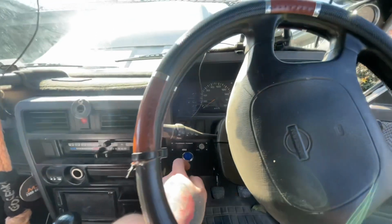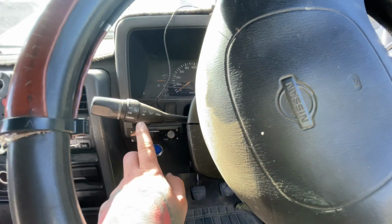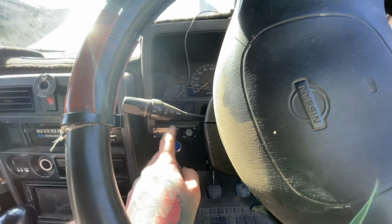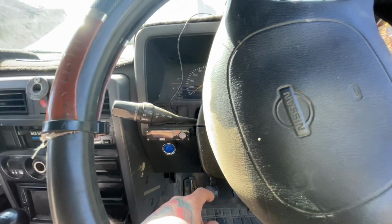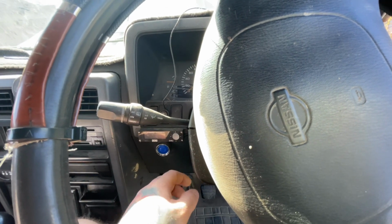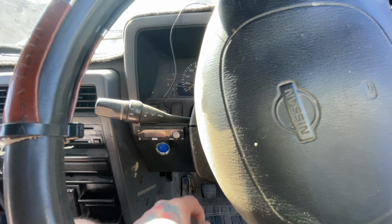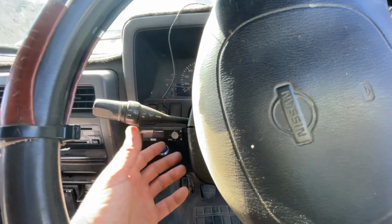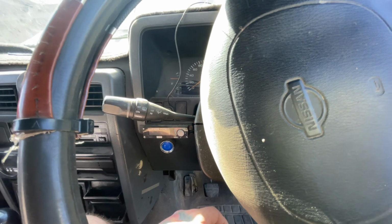I've got an HKS turbo timer, again, I got off eBay, I believe it was. You don't need it. It's more wank factor, but when I do pull up, I always let this bad boy warm down anyway. So I set it to 30 seconds and I get out. By the time I walk away from it, it's normally shut off. So it's up to you if you want to do it. Heaps easy to fit up. Throw one in. You can set it to a minute. I think this one's 30 seconds, a minute, or a minute and a half. So if you really want one, chuck it in. It just saves you sitting in the car if you don't want to let it warm down.